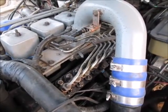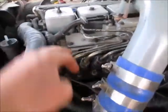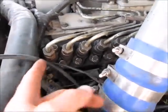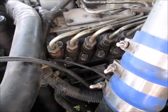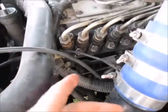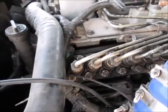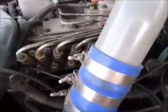The main thing is they want you to put well over 300 psi of fuel pressure into the pump, so you've got to plug the overflow valve off and all that stuff. You really don't need to, because the reason they want that much pressure is to force open the delivery valve. What you can do is just remove the delivery valve — remove that spring and the delivery valve and whatever else is in there — put it back in, and you're good to go. You don't need that 300 psi; all you need is 10 psi.